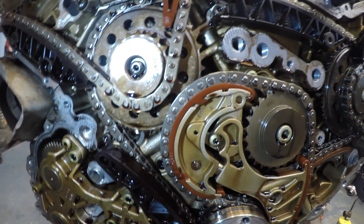We're checking in at the Red Barn with the 4.2. We took the phasers off — we just loosened the cam bolts for the phasers on each side. We got a shipment from ECS: cam lock tool, valve spring compressor tool, the timing chain kit, chains, guides, seals, serpentine belt, sealant. We're getting another order from FCP Euro as well. We're taking the cam phasers off, taking the cams out, the cam caps off, and then taking the heads off because we have to check the valves to see if any are bent — the timing jumped. Some of the pistons look like they may have barely kissed. We gotta take the heads off.